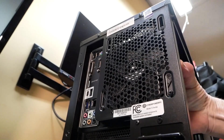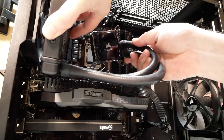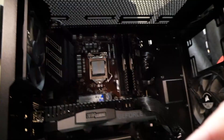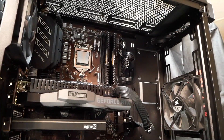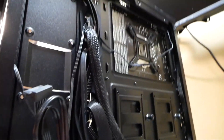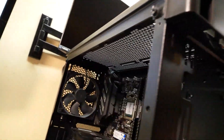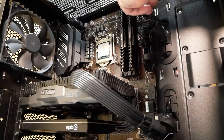Let's see how loose we are — we're still attached. Going to gently remove the cooler and keep the fan in place. I'm going to use the fan screws from taking this off. That exposes our processor. Now I can remove this fan; its cable comes through here and it's wrapped up in wire ties and a zip tie which I'm going to take off. I can follow that fan cable back to see what header it's plugged into and simply disconnect it.